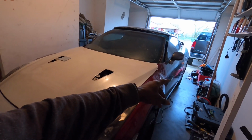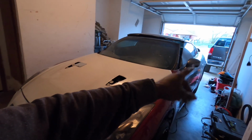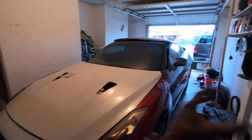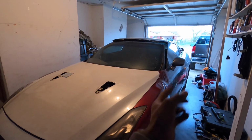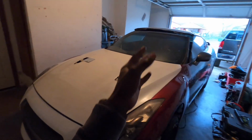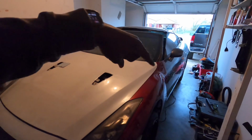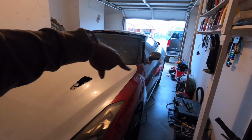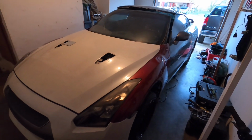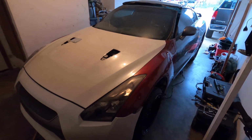After I do that, I will probably pull the little dents out, or I might do that first, I don't know. So let's think about this. I'll pull the dents with the stud puller, hard mount the doors, and once everything fitment wise is good, when I say fitment wise, I mean the outside of the body. I don't mean the front windshield piece. I'm not worried about that right now, but everything I want to look OEM all the way around. So all the way around will be OEM GTR. And once I get it like that, I will then be able to start welding.